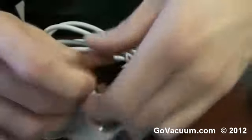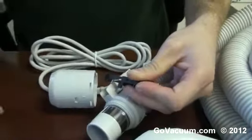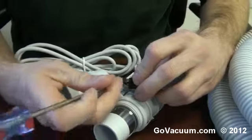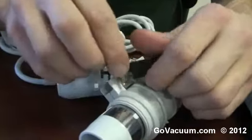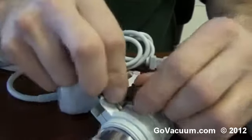One is pushed in on a cylinder here and we're just going to pull this one straight out. You want to be real careful when doing this. What you can do is take your flat head and put it back here, or you might want to grab needle nose pliers. If it is in there tight like this one, take needle nose or just take your flat head here. It pops straight out like that, and on this side we have this grommet and we just want to pull this off really easily with our fingernail, or we can take the flat head again and push down on that.